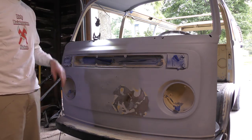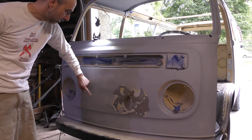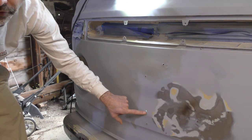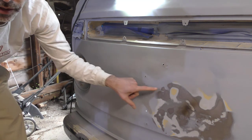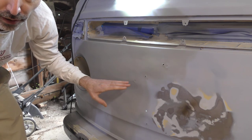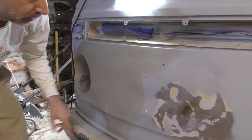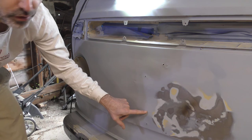I'm going to just focus on this nose today. I'm kind of sick of doing sanding, but I'm going to have to sand this entire part back and then level these holes. These holes were caused by my stud welder — this one, this one, and this one. That's a factory hole right there — the bigger one, so I'll leave that. This is a factory hole, there should be three of them for the logo, but what ended up happening is the old logo holes got bastardized on the previous logo install with sheet metal screws and hackery. So those holes ended up opening up with rust and we just welded them back in. I'm keeping this hole here — it's untouched and a perfectly good hole and I'll use this as a reference point for the logo.